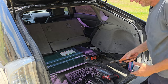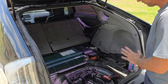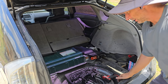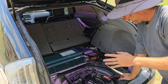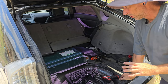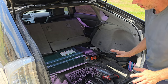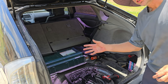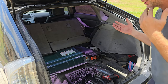So we'll just get rid of that solar issue. We'll plug it in from now on, and then no more problems. My guess is that the BMS inside the solar charger might either not work with the battery, or it went bad, or the battery could be bad and is letting itself be overcharged. I don't know, but the best way to diagnose that is to slowly take out aftermarket stuff one at a time, especially if you don't need it. I don't need that right now.